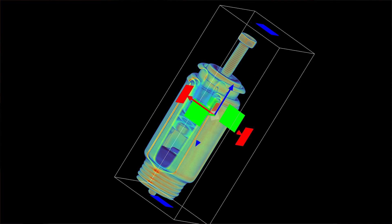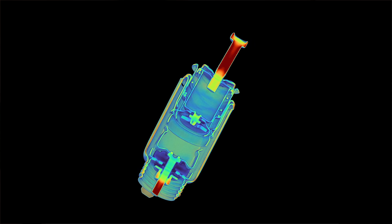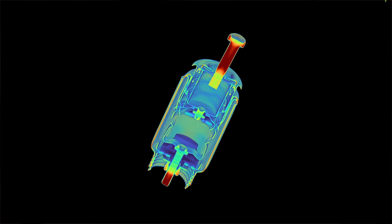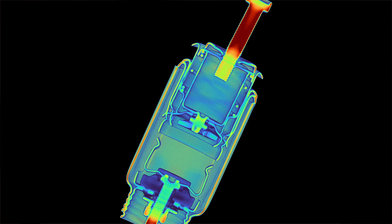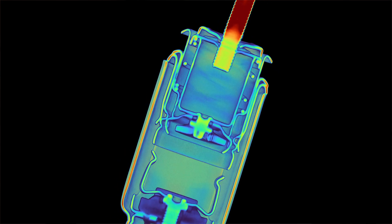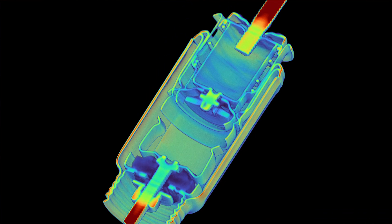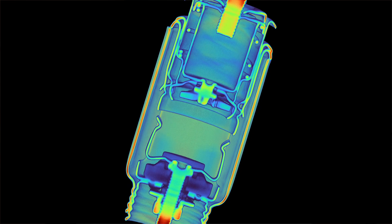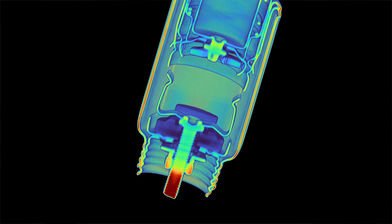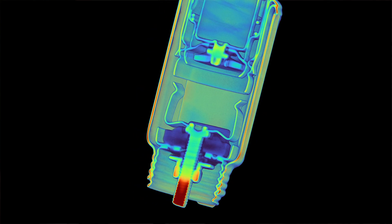When we cut in, we see the removable lighter with a giant bolt on top that fixes the plastic handle to it. Around the walls of the handheld lighter, there's a single coil spring. The heating element is visible in the center of the assembly, and below it is another bolt attached to the two arms of a spring clip. The coloring in this image indicates relative material density — most of this assembly is made of stamped steel, but the darker area around the lower bolt is a ceramic insulator.